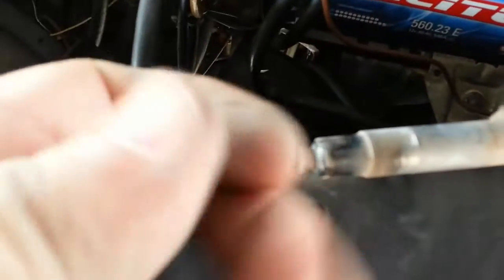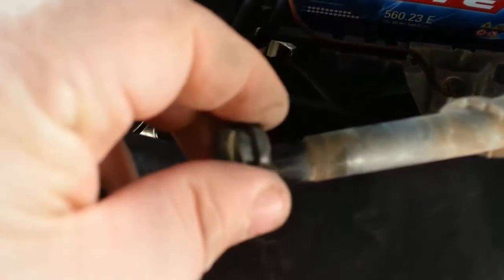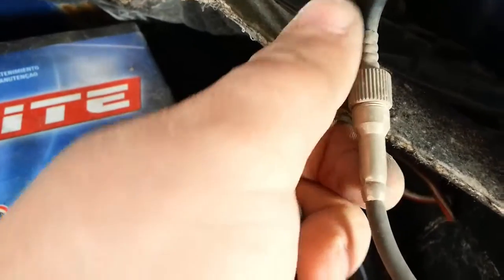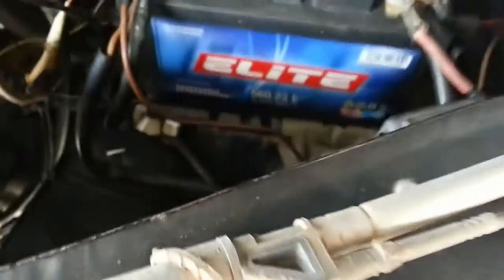There's a little nut that fits over the top. The easiest way I found is holding the top and just spinning the antenna. The reason I do that is so I don't hit the windscreen — I'm in a tight gap, so I just hold the top and twist the bottom to slowly undo it. Now we've got the antenna out. You can remove the connector by unscrewing it, which gets rid of the old assembly so you can put a new one together.